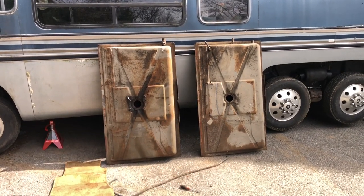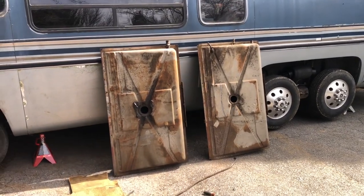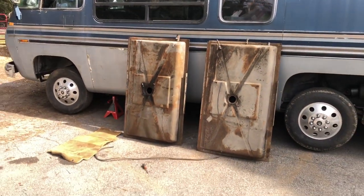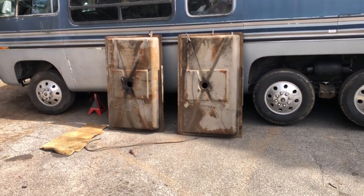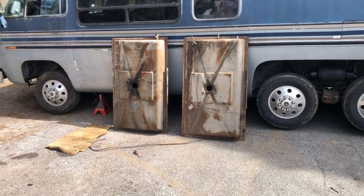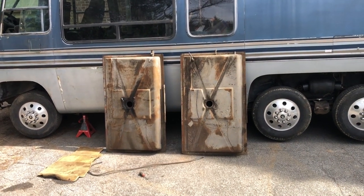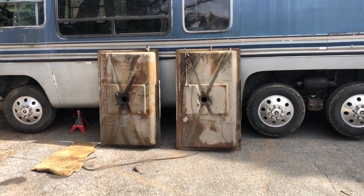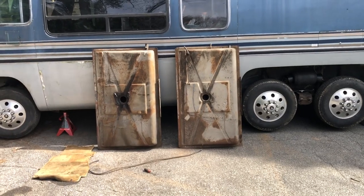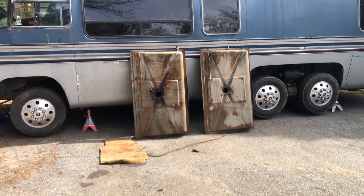I was so happy when I found those holes drilled in the floor — that did make it easier for dropping the tanks. If I'd had all those extra lines on there it might've been a little trickier, but it saved me a few minutes. Without all the filming and blabbing and putting tools down, that's maybe a 40-minute job — very easy, very quick. I was dreading it and now it's done. There is definitely some slime in the tanks, but when I rub it it comes off and there's metal underneath, so I think I caught them just in time. I'll take them to the tank shop and they'll dip them — hopefully they'll come out decent inside. I can paint them, and if I ever decide to sell the coach I can say it's got clean tanks and new sending units.